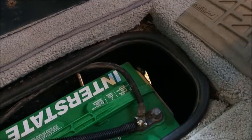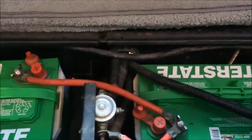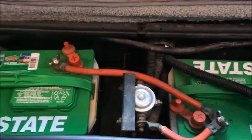You need to take note that there are engineered breathing holes in the battery pan itself. This allows this particular area to breathe while the batteries are charging. You see, as you're driving down the road, that's when your coach batteries are being recharged by your system. Anytime there's recharging of those batteries, with the rare exception of the higher end gel batteries, you're going to have some off-gassing. What happens in this case is as you're driving, the batteries are charging, those vent holes underneath the coach allow that battery compartment to breathe. It takes the gases out of there and leaves them behind you down the road, where they should be,